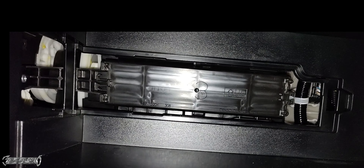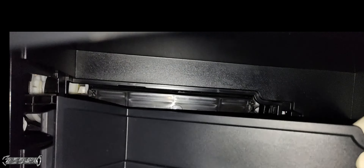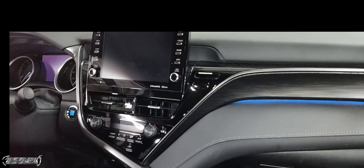Sometimes the tray just won't work right, and other times you take it out, put it back in, and it works. Put the glove box door back on — get the left side tabs in first, then walk it over and clip it in place. That little clip will lock, and that's how you do your cabin filter.